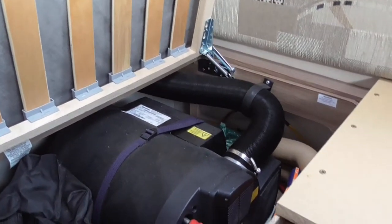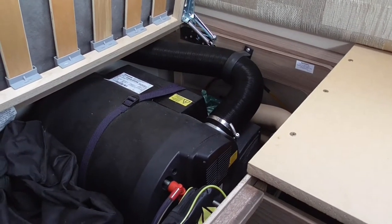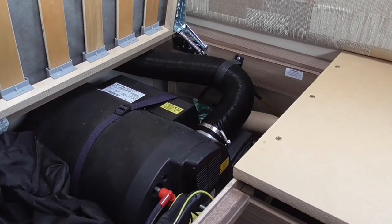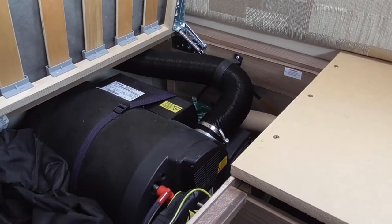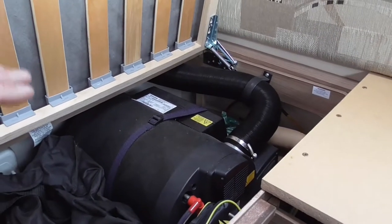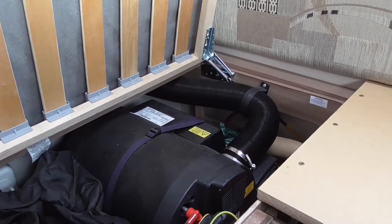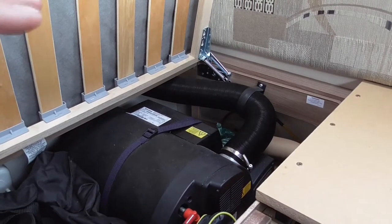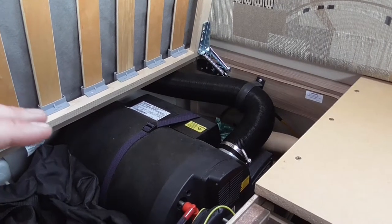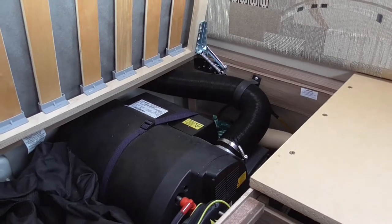Over there is the Truma heating unit, which does the hot water and the heating system for the blower. One of the good things is it's great during the day for heating up the van and quite fast for heating up hot water, but at night time the unit is right over where one of the people will sleep — it heats up the whole bed and bedding area, and the fan starts up which isn't noisy during the day but when you're sleeping over the top of it the noise comes right through. So in the end we've had to install a separate heating system just for night time.